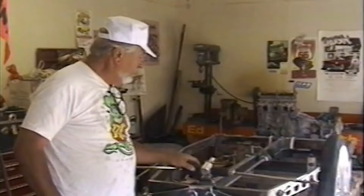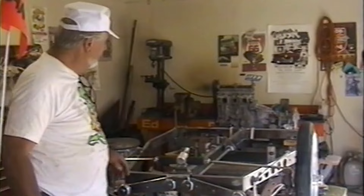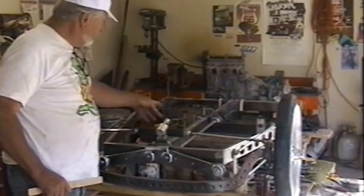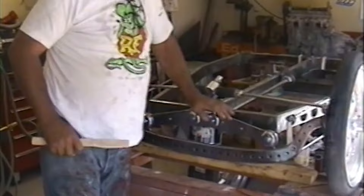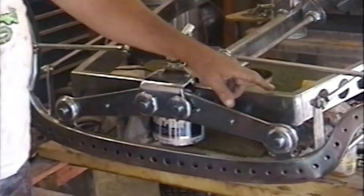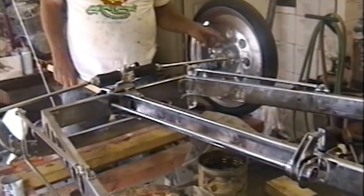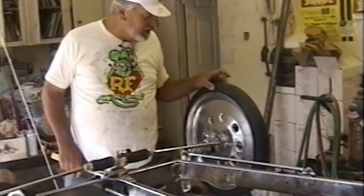It's a pretty 99% success thing because a lot of people now know what a Metro is and they're pretty good sales items. So I started out with that in mind. Then I wanted the whole frame chrome plated and I wanted the torsion bar system, because most of the rods you see don't have a spring in the front. So I decided to make all my joints so that they could be taken apart and chrome plated. When I looked around for steering systems, I decided to use a drag race steering box, and the front wheels had to be drag race wheels. I used the Kreger rims and put these Eagle tires that Goodyear makes.